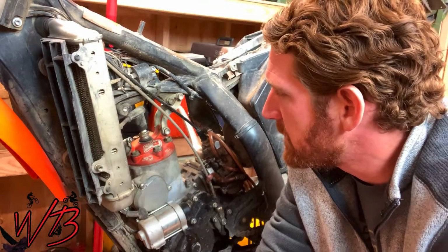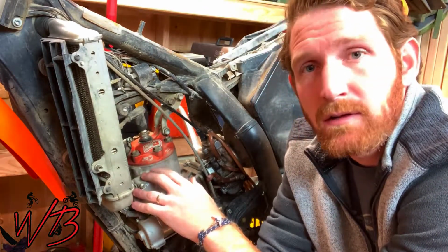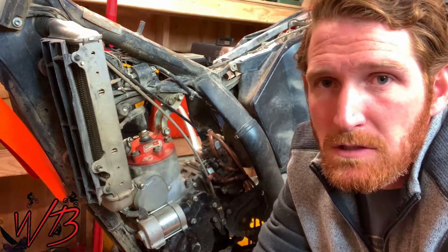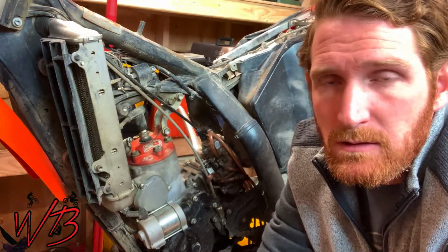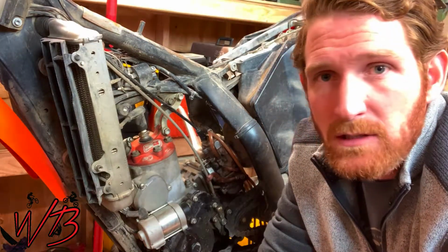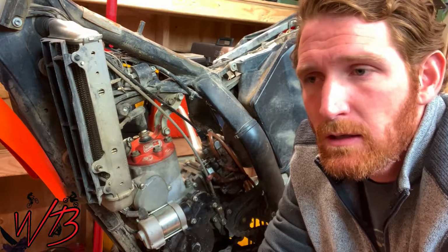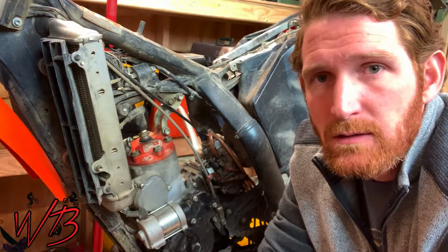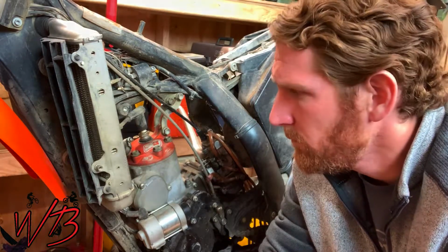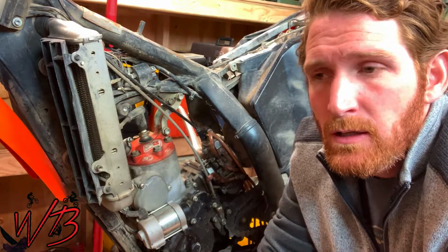Basically, that's a 2013 to 2016 cylinder, and all the computer and everything was changed out. What that was supposed to do was bring the bike up to the 2013 to 2016 model range, to give it more torque, because the exhaust port on the cylinder was a little bit lower, which increased the length of the power stroke and gave you a little more torque and performance.